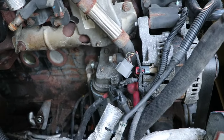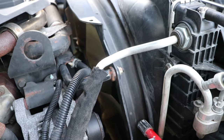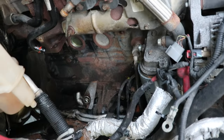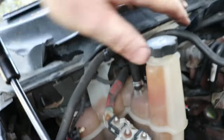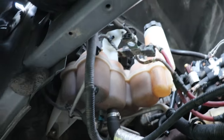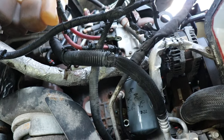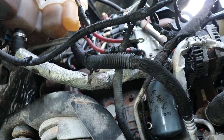This truck's been apart a few times — I think it's had the heater core replaced once and a radiator replaced. It's got 260,000 miles on it, so it's kind of expected; things are rough. It would be a good time to change the expansion tank — eventually the coolant sensor on the bottom is going to fail and it's not replaceable. I'm going to run water and coolant system cleaner for a while after I get the turbo back in and flush out the heater core a couple more times before putting in the proper coolant again.